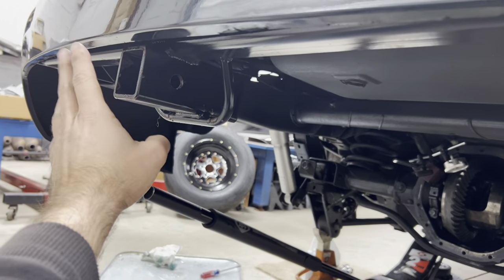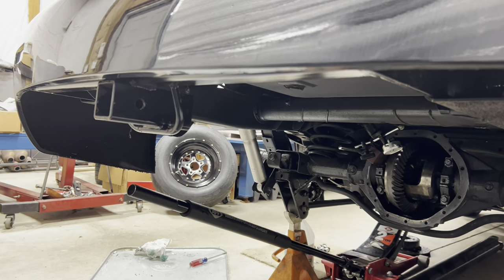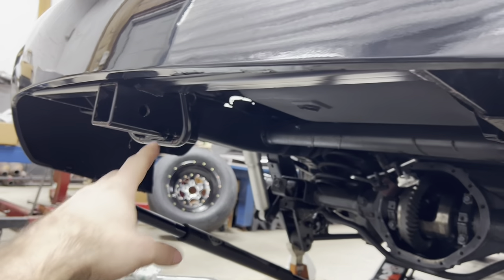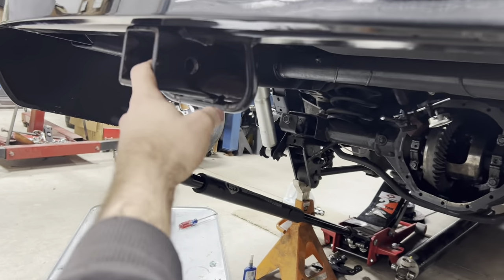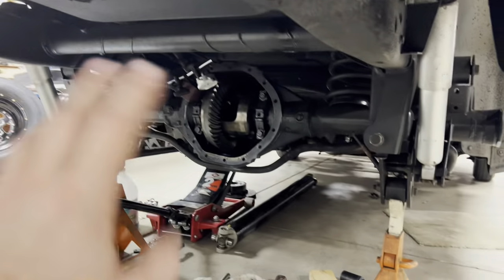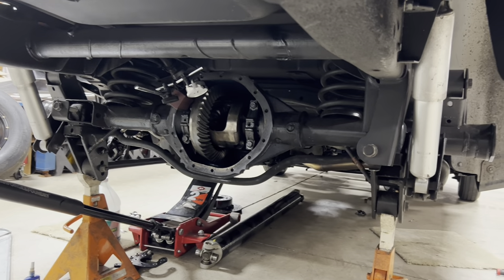We threw the custom hitch back on — made this back in 2019 for Drag Week when we pulled a little 4x8 trailer. The factory one is super heavy and hangs kind of down, so I made a more lightweight hitch. With the cup bumper it's pretty much dead flush to the bottom, so you don't even see any of it other than the square receiver. Got that bolted back up — as soon as we get this all squared away we'll throw the muffler back on, because we pulled that off just to save a little weight for that record run. The clock is ticking — we haven't even started putting the cage in this thing yet and we need to be in Florida in a little over a week.